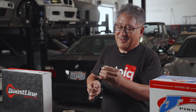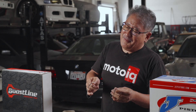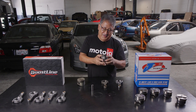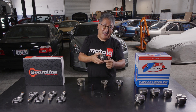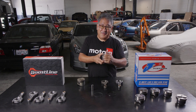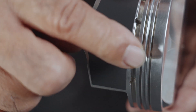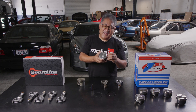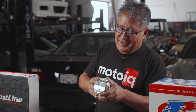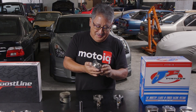The oil ring is a really thin one with really thin rails — the scrapers are really thin — so this gets the job done scraping the oil off the cylinder walls and it's also really low friction. When you look at the piston you can see that the oil ring grooves have a lot of drain-back holes so it can get rid of the oil scraped off by the oil ring. There is also an accumulator groove between the top and bottom compression rings. The accumulator groove acts like a gas reservoir — as the piston's moving up and down there's a little gas to get under the second ring to help move it out against the cylinder wall to maintain better seal.